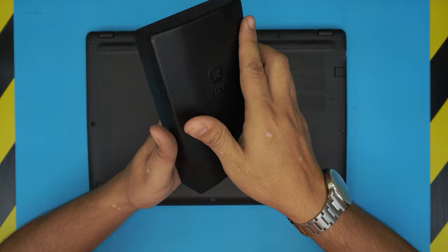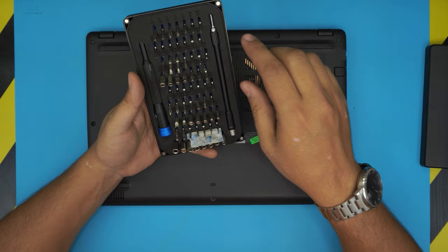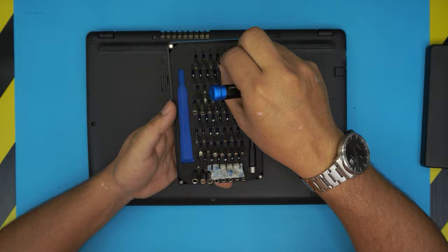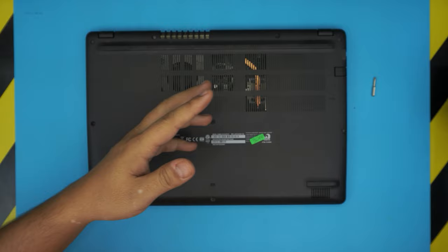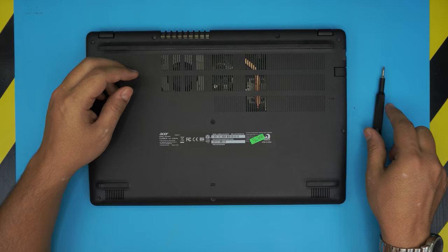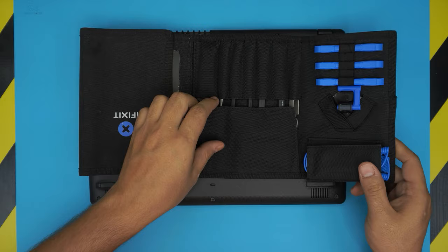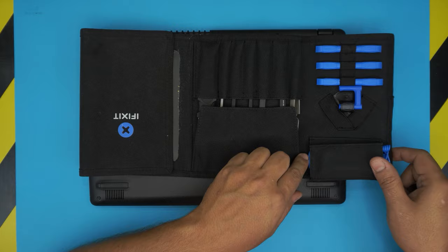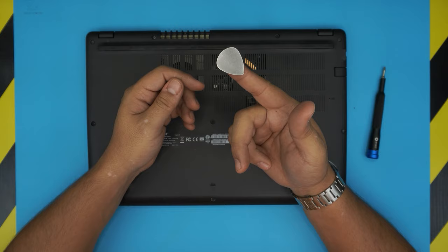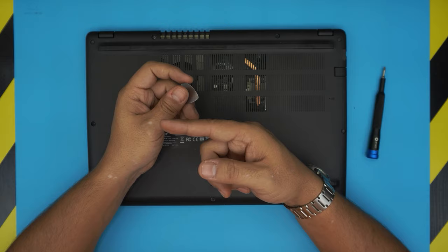To get started you need a few tools. The first is the iFixit screwdriver set — these are really good and will last a long time. From this set we're going to use a Phillips number zero. I'll leave a link in the description. They also have an extension with opening tools and anti-static discharging cables. For an opening tool, I like to use a metallic guitar pick rather than the one included in the package.